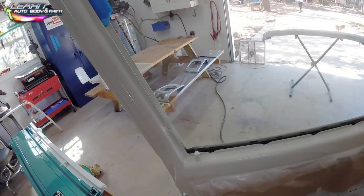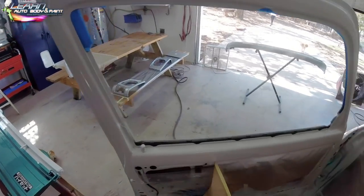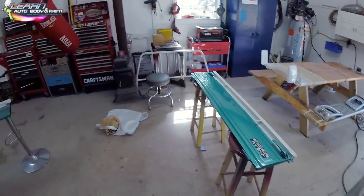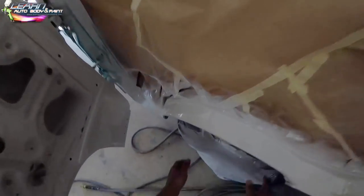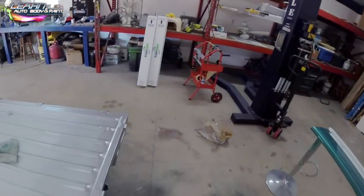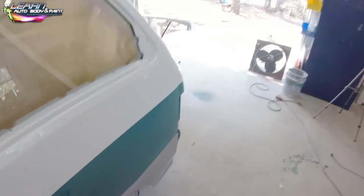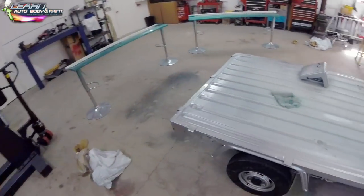And like I always say, it's super, super important to start peeling your paper off of your painted project about an hour after you paint. A more certain time frame would be when it's tack free, right? When you can actually lay your finger on the paint lightly, like touch it like a feather, and it doesn't stick to you. So you would basically test that by touching the masking paper, right? Once it's lint free, dust free, tack free, as I like to call it, then go ahead and pull off your paper. This is because the paint is still going to be a little wet, right?